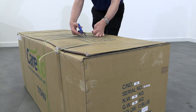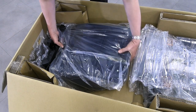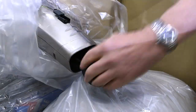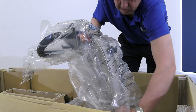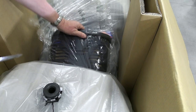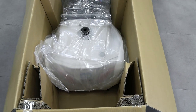First, carefully cut the tape with a knife or a pair of scissors to open the box. Lift out and set aside the seat and arm rests. Turn the dial on the bottom to unlock the tiller, then lift it by the handset, then twist the dial again to lock the tiller in a fixed position. Lift out the front basket then remove excess packaging to access the main scooter body.